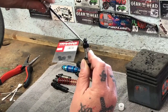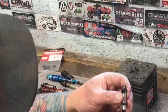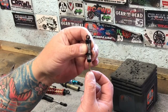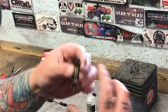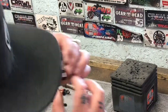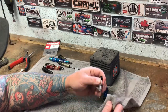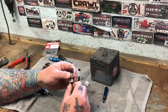Take this set screw, get it in the hole and drive it home. You can see the angle at which the set screw is going into the shock cap — that's the angle you want to drill it in. To me, that's when I know a shock is filled properly — it draws it back up. You can also listen to it: if there's any air in there it's going to be crunchy or squeaky. If you get any crunching or squeaking noise, you've done it wrong — go back and do it again. As always, we promote using Team Associated green slime on all the seals when you're building your shocks, as outlined in the King off-road shock video.